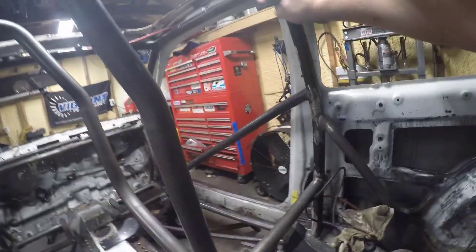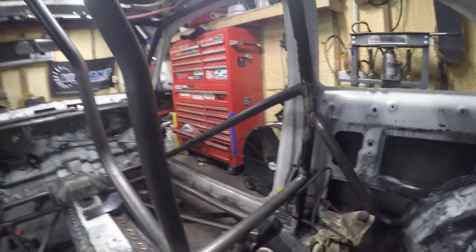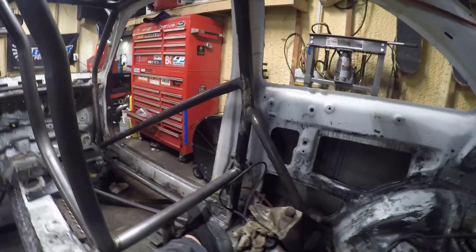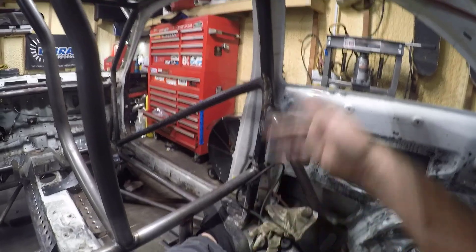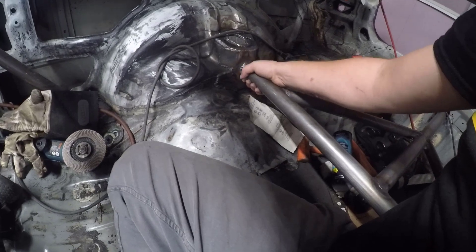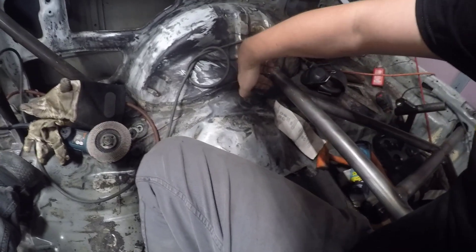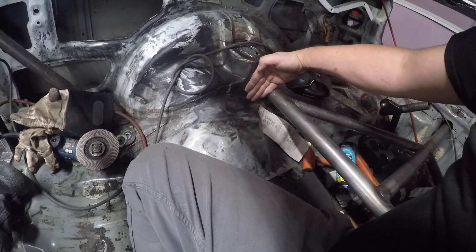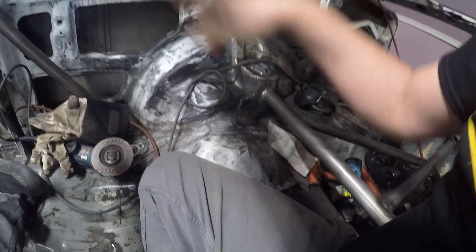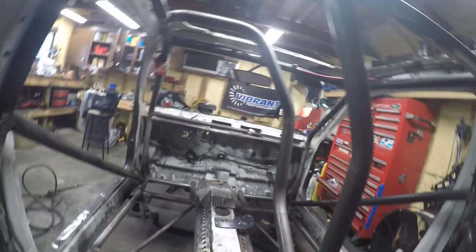It's actually a new day now. It's cold, thanks to Virginia weather - 85 degrees one day and 55 the next. Time to get our rear bars. You can see where I left a little bit of the weld of the old one just because I didn't want to go under to the sides of my tubing. Once it's painted and windows are in, you're never going to see that. Rear bars have to be inch and five-eighths, 083 chromoly. I really wanted to come out here as far as possible, however I don't want to get myself in a bind where I can't weld right down in there because you really can't get the TIG torch. So I'm going to come back about four inches, and I got to measure up some stuff and get some bars cut.